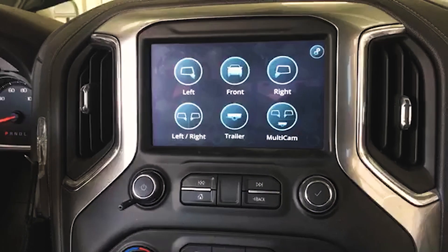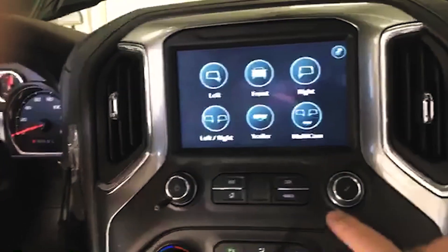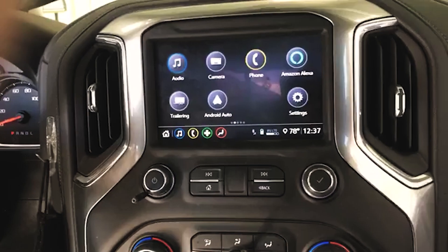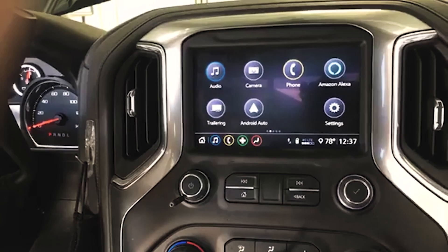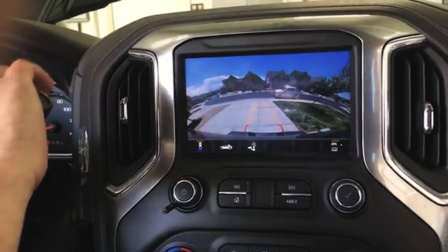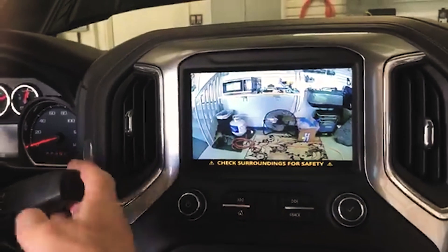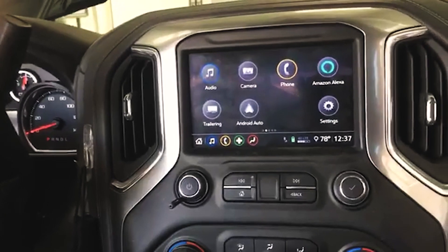The auto-trigger does turn on in a parking situation — it's got to see reverse first, as if you're pulling into a parking spot. There's your factory camera. Flip the shift to drive and the front camera turns on automatically. That will stay on give or take up to eight miles per hour — it's not 100% accurate, so if it shuts off at seven don't call me. It's electronics reading data, and data does funny things, so give or take a couple miles per hour. It will auto turn off once it gets above eight miles per hour.